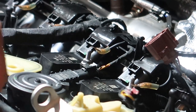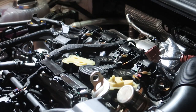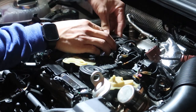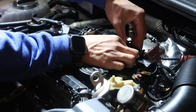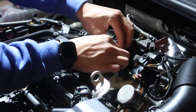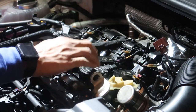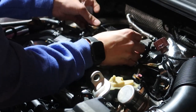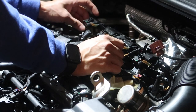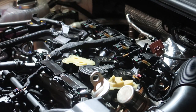That's the second reason right there. Taking off grounds and coil packs is quick — just a 10mm, boop boop boop, coil packs out, not having to deal with all this extra stuff. The best way to get these off: press down towards the coil pack, squeeze, then lift up. Down, squeeze, lift up. There are extra things to undo like the O2 sensor and the PCV sensor, but we'll get this all lifted up and then pop open these caps.